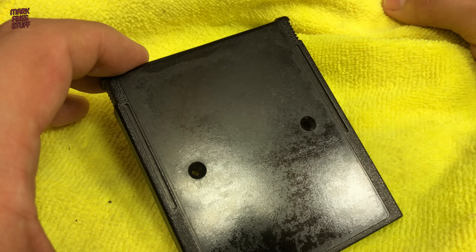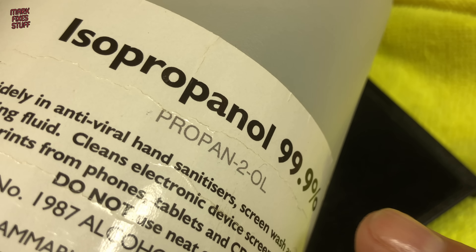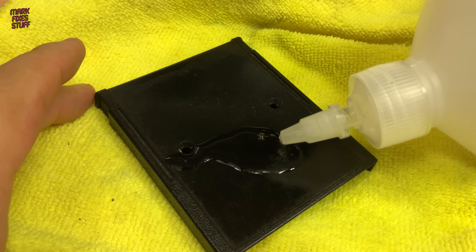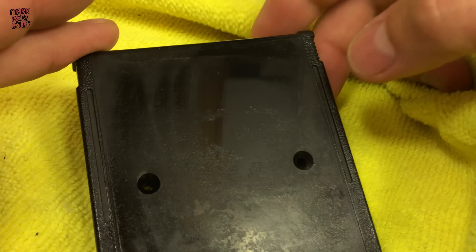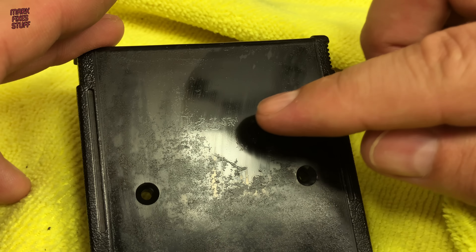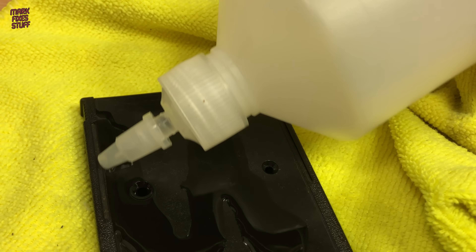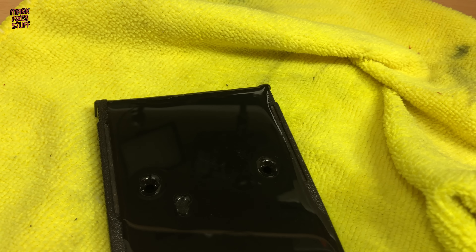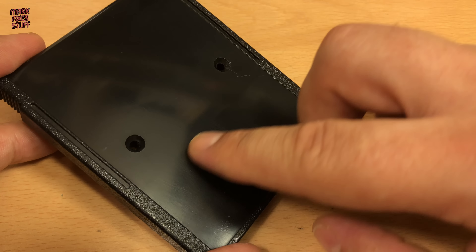With the inside of the cart clean, we need to get this glue off. For that, we need isopropanol alcohol — IPA, as it's more commonly known — which is a solvent and does a good job of gently breaking down the old glue. But even when chemically assisted, it's slow going. Eventually though, the hard work and perseverance pays off and we're left with a shiny shell.